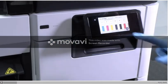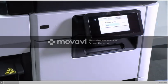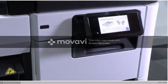To replace the maintenance cartridge, go to the printer's front panel and tap the inks icon. Then, at the right-hand side of the screen, select the other supplies tab, then select maintenance cartridge, replace, and finally press the blue arrow.